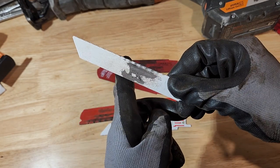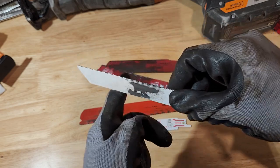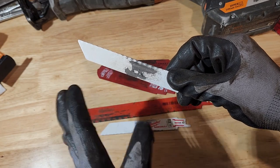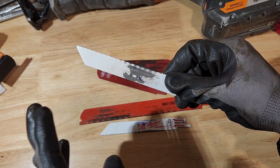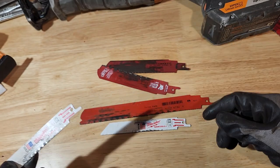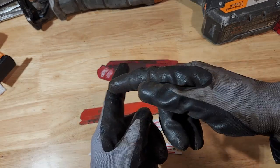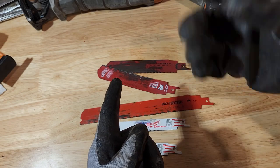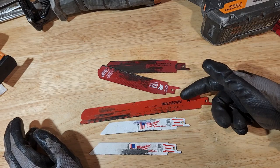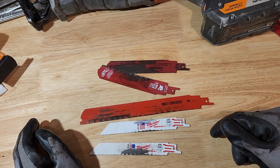And you're basically just rubbing this soft edge on the bushing or the material, and you've gone from seeing silver dust or metal fly off to seeing some smoke or maybe some flames or sparks coming off the blade. Then what happens? You have to take the blade out, put in a new blade, you run the Sawzall real fast, it cuts a little bit, loses its edge, you start to see smoke, flames, sparks, and you've lost the blade again. Then you go to the next blade. All of a sudden, you've gone through five blades and you still haven't finished cutting out one bolt.